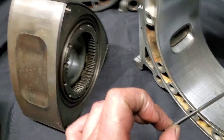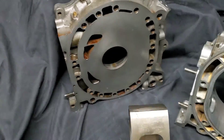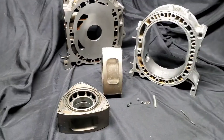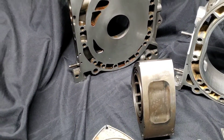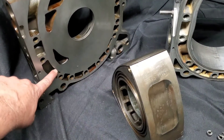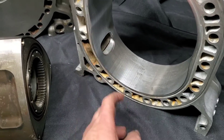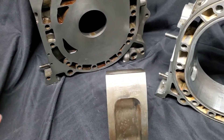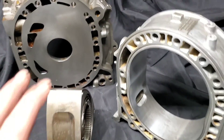MazdaTrix does that — send them to KMR. That way you can run a traditional RX-7 seal with your traditional RX-7 rotor housing in combination with your Renesis motor. This really came down to MazdaTrix wanting to win their class by creating a motor that made more horsepower, but we were also trying to relieve an issue under aggressive conditions. Renesis motors have a tendency to stagnate heat around the exhaust port, shrink that area of the side plate, and often have water seal failures there. By getting EGT and heat out through more exhaust port, we saw less heat stagnation and better wear characteristics in our Renesis motor.